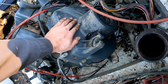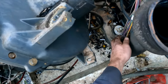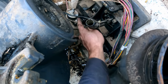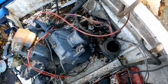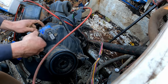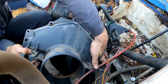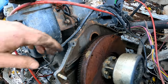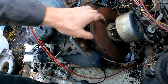All right, that only took about 10 minutes. Now we can pop the housing off the flywheel and I'll show you that plug. These are the only two things that hold the engine in — just two bolts, one front and one on the back motor mount, and then of course the front one which we already had off. Let's get that off.